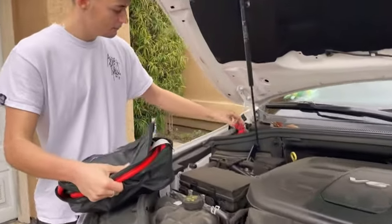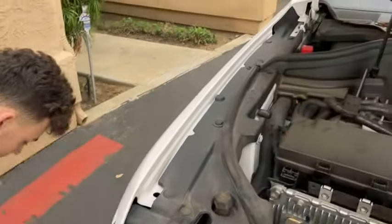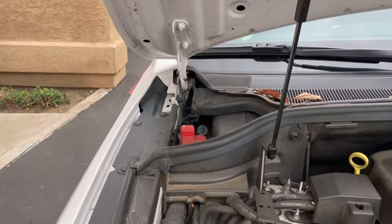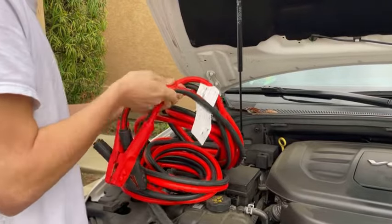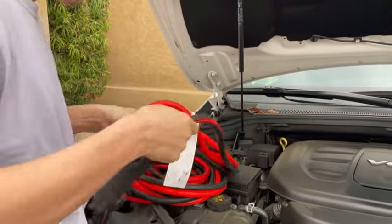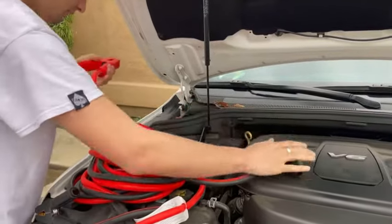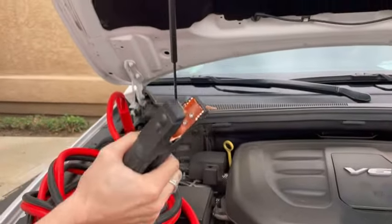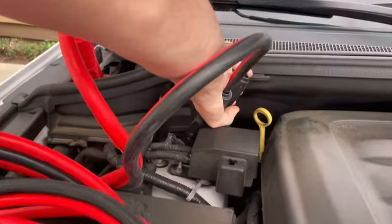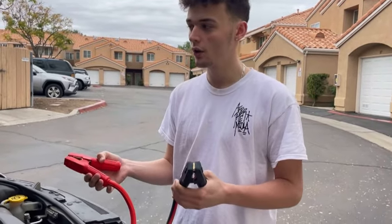Over here you have your positive side for the battery. Take the jumper cable out of the bag — there are two different sides, two positives and two negatives. These are 25 feet long. Take your positive side and connect it to the positive side of the battery terminal. Then take your negative and connect it onto anything metal that is a good ground. Now you would take the other end on the other car and connect the black onto the negative and the red onto the positive. Turn your car on and your car should be good to go.